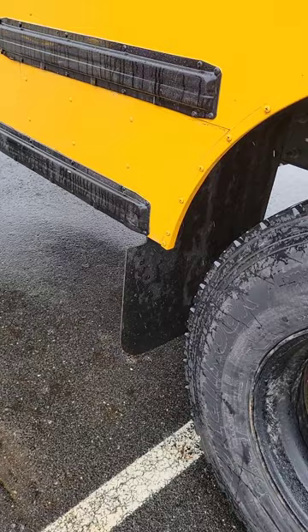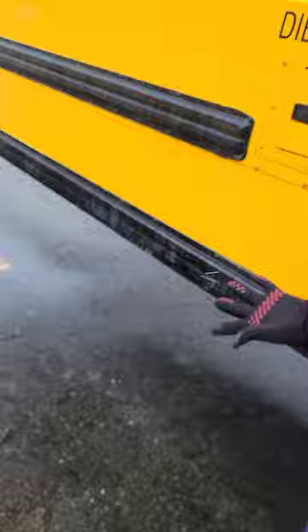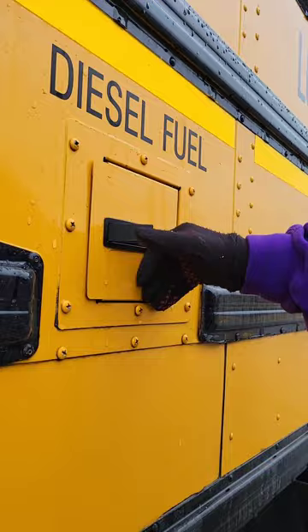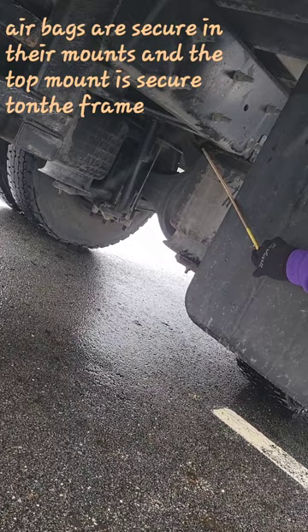You can do the airbag and torque rod through here, or you can come back behind the mud flap and do it with the fuel tank — I get a better view there. The mud flap is not ripped or torn, secure to the bus. When I open the fuel door, the fuel cap is tight — I do not see or smell any leaks. The fuel tank is secure in its cage, the cage is secure to the frame, I do not see or smell any leaks. My airbags are fully inflated, not ripped, not leaking. There's a torque rod between the frame rails — it sits diagonal between the frame rails, is secure and not bent. You will not see it unless you get completely under the bus, but you do have to mention it.